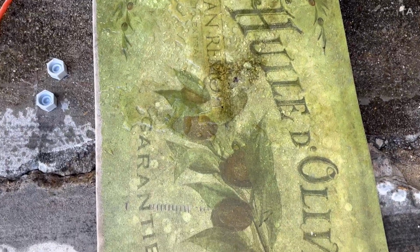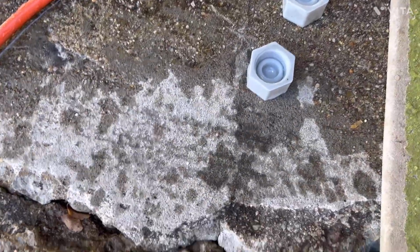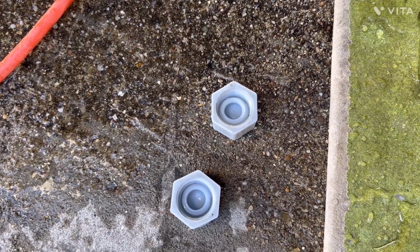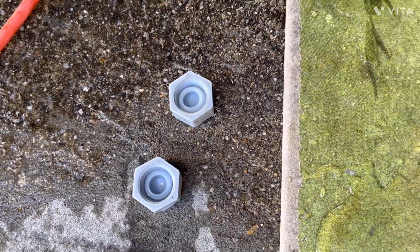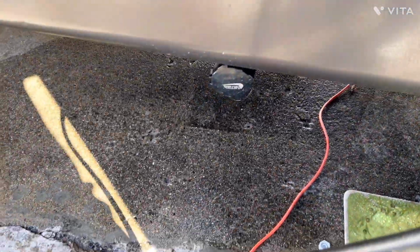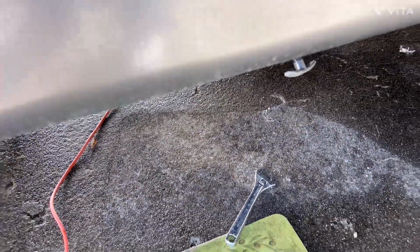It was kind of hard for me to videotape that, but you can see the water that squirted out of them. Now, on these caps on mine, do you see the little inserts? You must make sure that they are there so that it will stop all the water, because if the low point drains do not have good caps on, you put water in your RV and it'll start leaking out. So let me go ahead and add some air. And as you can see, I'm getting a little bit of water dripping out of there.